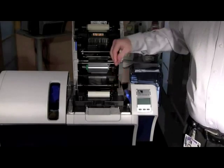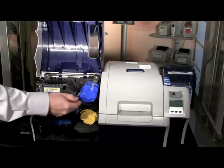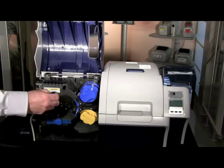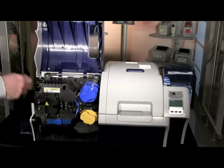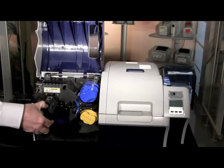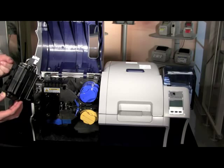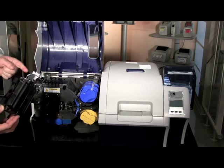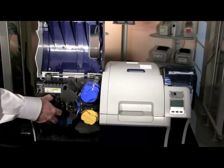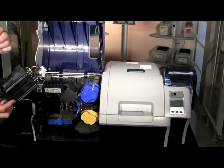Remove your heated roller assembly from the printer and remove the card should it be jammed in this area. Because during that process the gears on the heated roller assembly may have moved, you want to make sure this is cool enough that you can move the gears to correspond to the gears inside of the station before reinstalling it, to ensure it seats properly. There is a tool in the front of the printer — remove the tape if you haven't already, then twist the tool to remove it. It has slots in it to act as a screwdriver to engage on the rollers and help churn the rollers and move the card in the printer. Be careful — many of these rollers will only move in the direction of the exit; do not move it back toward the printer as you can cause damage.